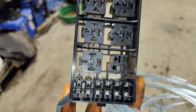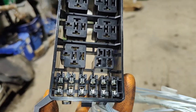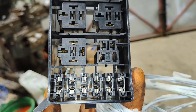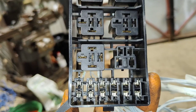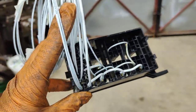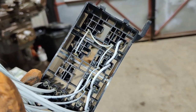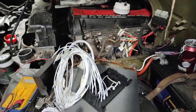If I'm broken down and the engine is off, at least I've still got my hazards and sidelights. Fuse 2 is left headlight, fuse 3 is right headlight, fuse 4 main beam, fuse 5 is the heater on its own because that's quite high amperage. Then I've got wipers, washers, horn, indicators, brake and reverse in the final fuse. I've used a mixture of 12, 14, 16 and 18 gauge wire, and pre-populated some of the relays so I can use them in the future. It's all one colour for budgeting reasons - and honestly, in my experience, if you're going to be chasing faults you don't want to be chasing colours, you want to check everything anyway. The usual disclaimer: I don't know what I'm doing, I'm making it up as I go along. These aren't how-to videos.